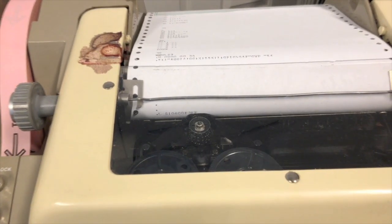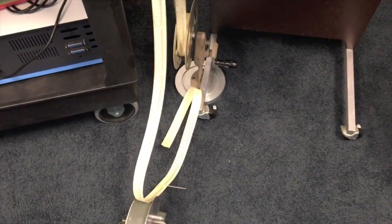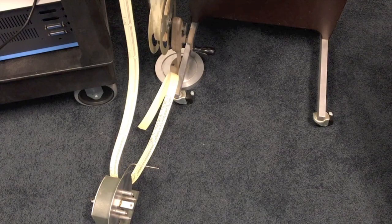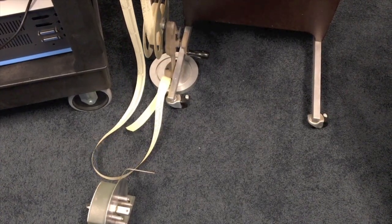You'll notice that it printed an S record and immediately stopped printing, meaning you can still hear the paper tape going. That S record is loading memory. This will save a lot of wear and tear on the printer — it doesn't have to print all of those S records. The very last S record in the file turns echo back on. I'm going to go ahead and get this hooked up to the take-up spool so I don't have as big a mess, and we'll take a look at it when we're done.